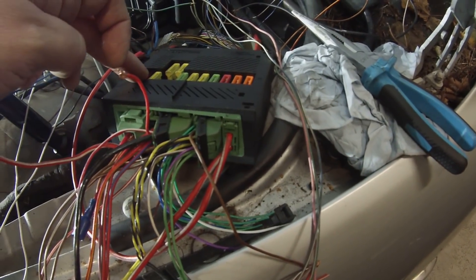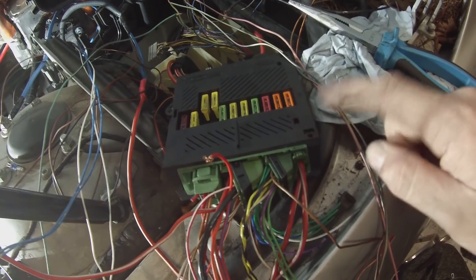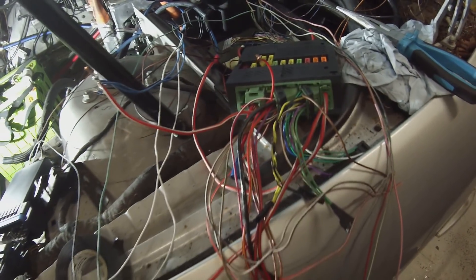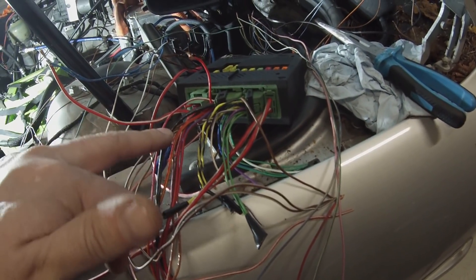Over here in the electronics box we've been pretty busily working out what wires do what. This is the IVM module, which is where the E65 controls a lot of the relays, fuses, and power supplies to things like the engine, automatic gearbox, and so on. We've been able to hijack that with our Lexus controller here, so we're now connected into the throttle pedal, brake pedal, and vehicle powertrain CAN bus. We're able to trip on power through the IVM to things like the inverter, the gearbox oil pump, and the power steering pump.